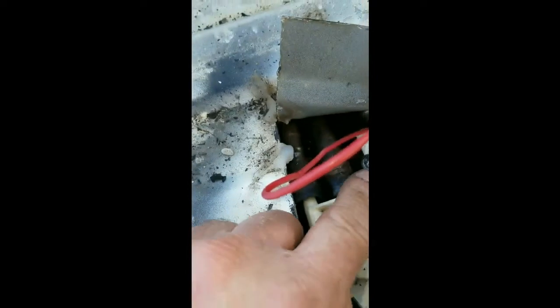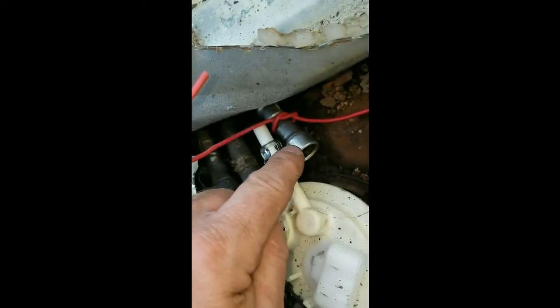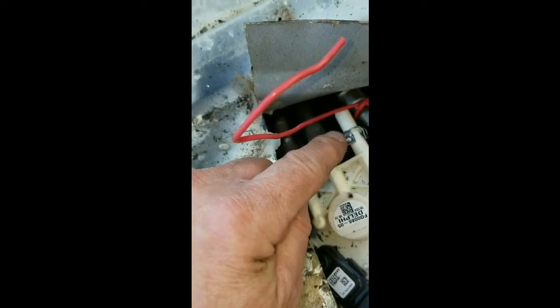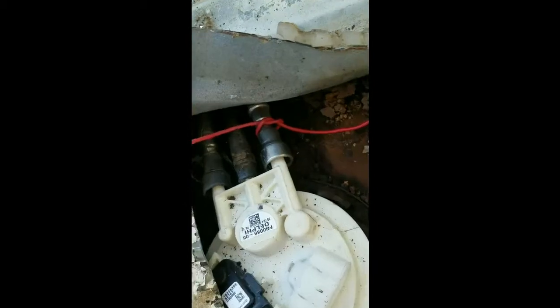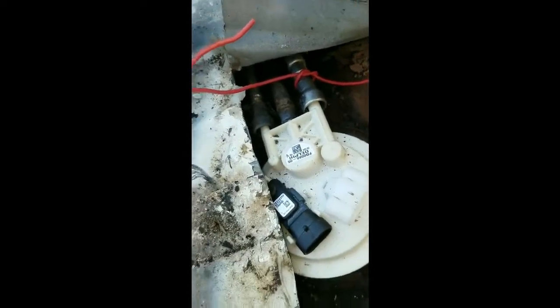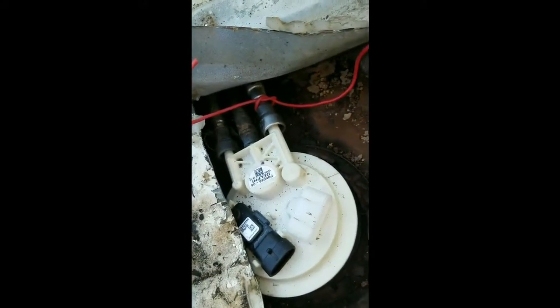And go from there. Have a little bit of problems with that clip, so what happens is that thing kind of sticks inside this gas line, but then it hooks around the little lip on here. So I'm going to go ahead and see if I can get that all the way in on there. Get the gas line over it rather. Yeah, that did the trick, so no problem. Let's get that wire out of there, and then I'm going to try to seat this fuel pump right inside there nice and tight.